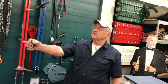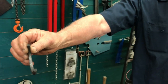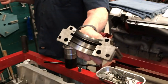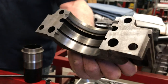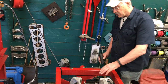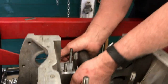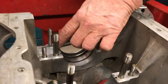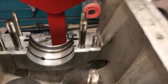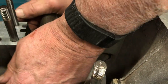What you do — and this is what a seal half looks like before you install it — I already have the other half in the main bearing cap already. So what you do first of all is you place the seal half in the groove after you put a little red Loctite in it. Then you work it back and forth, trying to maintain the same dimension on both sides, because the length of this seal is really, really close to what it's going to be when it's actually sized properly. So you sort of work your way toward the center.